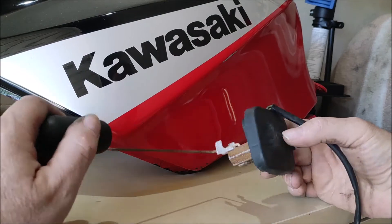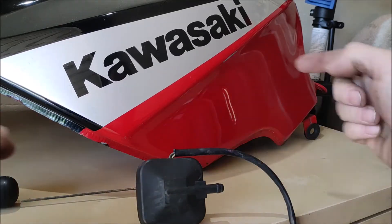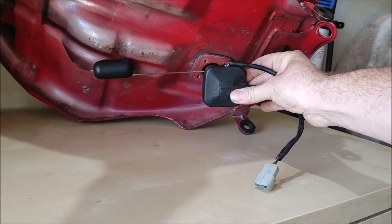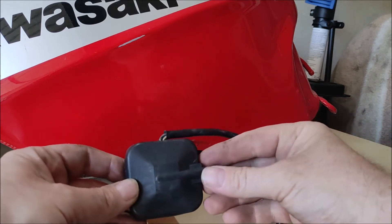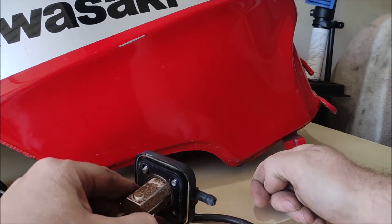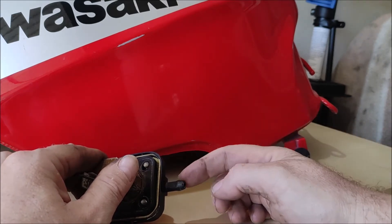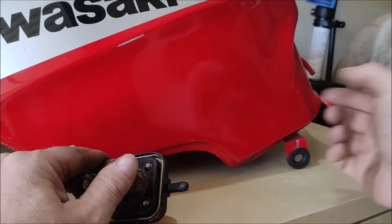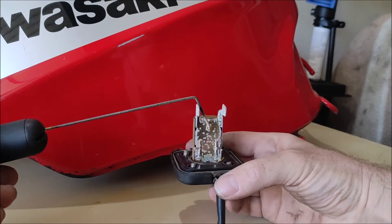How does this work? All you see on the bottom side of the tank is this cover here. Some people ask what the overflow is for — well, should the screws become leaky, fuel doesn't drop underneath the tank onto the hot engine. It gets caught in this little cup and is drained away. It makes sense to put a tube on there so it drains out somewhere to the side of the engine. That's what that's for.